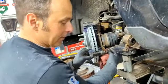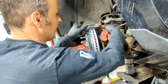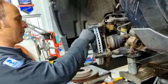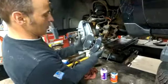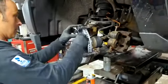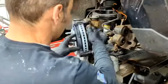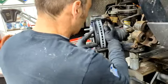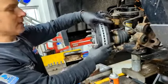We don't have the tool to tighten this up here right now — it's on the other side. Let's assume that this bracket is tight. Here are the new brake pads — they're going to go installed here and they're going to move nicely. Two pads are different: one is thin and one is thicker. The thin one goes on the outside. You can see that the spring action of these clips is what's actually going to easily pull back your pad.